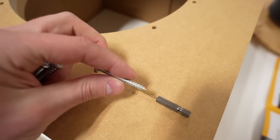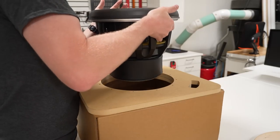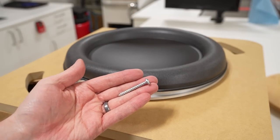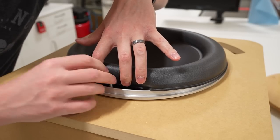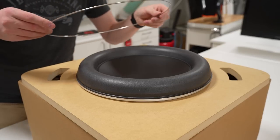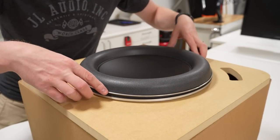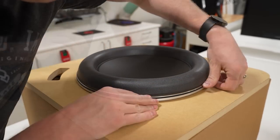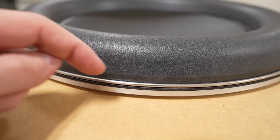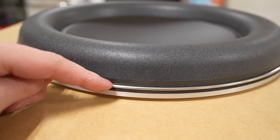Taking the time to pre-drill with a small drill bit makes the mounting process a lot more simple. Once we position the W7, we want to use heavy screws like the ones that were supplied with the sub. Avoid the use of inferior hardware like drywall screws, as that can lead to issues. Next, we're going to reattach the steel O-ring by simply placing it over the outside of the surround and pushing it down evenly. You should not push down on only one side first — make sure the O-ring is fully seated against the surround all the way around the subwoofer.